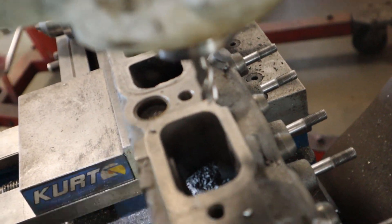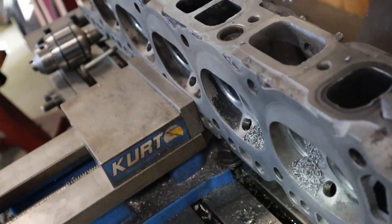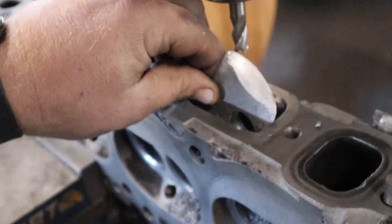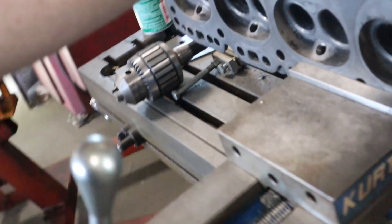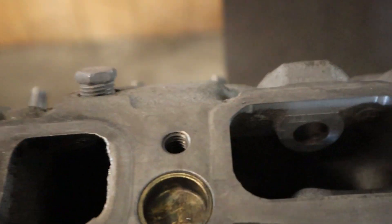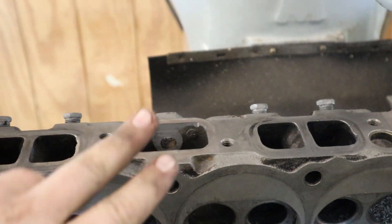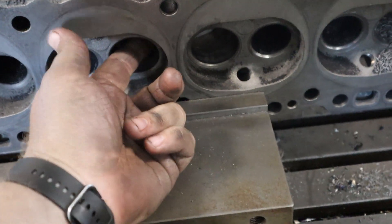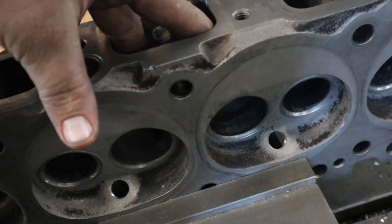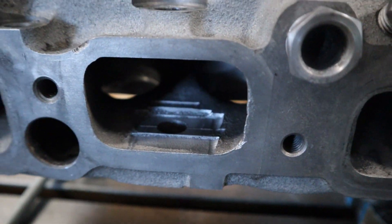Now it's really open in there — a lot more breathability. Now you can fit this lump in. It doesn't quite fit in there yet because I haven't clearanced it much, but this fits right inside there. The idea is the airflow goes in and it's a smoother transition on the intake valves. Kind of cool little stuff. We're getting there — it's a lot of work, but the hard part's done. Got that all cut out.